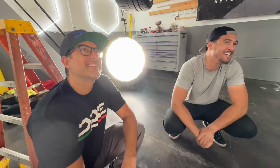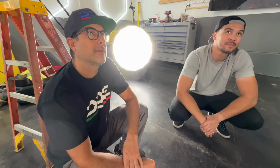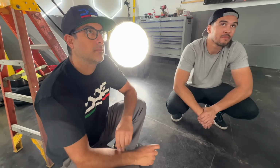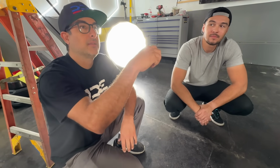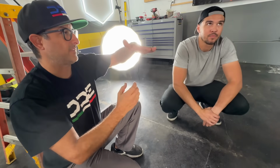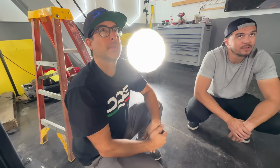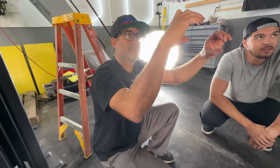It's decided. I figured out how we're gonna make the mounting points for it. I'll get some solid stock and drill it and tap it and cut them to the height. So we'll weld those onto a plate and drop those down from the top. It's basically threaded bungs inside of there, instead of doing a plate with nuts on top and a bolt that's kind of fishing around in the hole. You might smash it a little bit. So we'll just do bungs like that. For now, I'll just drill that hole through and we'll put a nut and bolt through to hold it in place, and then we'll machine that stuff.